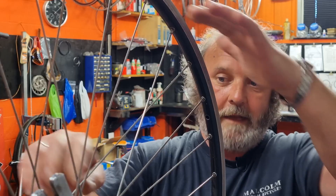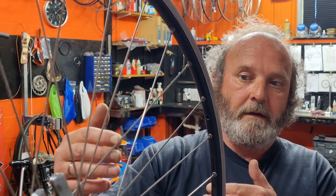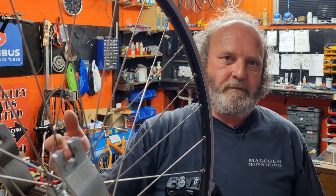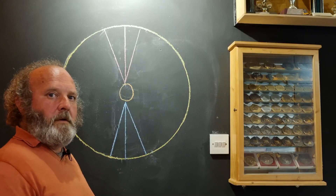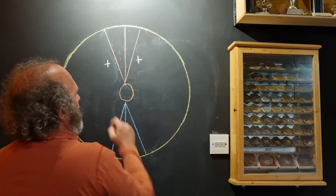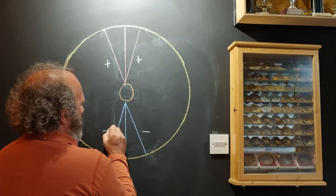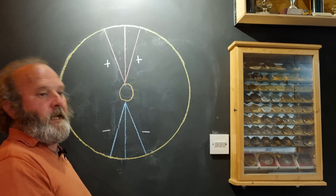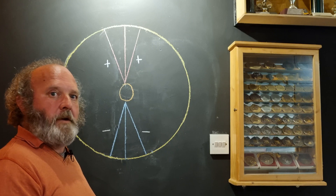Then it goes back around, the next spokes come up, it shortens, and it goes backwards and forwards, backwards and forwards. That basically weakens the spoke, and at some point it may just break while you're riding down the road. The weight on the back wheel makes the spokes at the top get tighter in tension, while the ones at the bottom get looser. So the spokes are getting longer and shorter as they spin around the wheel while you're riding along, and that's naturally fatiguing the spokes.